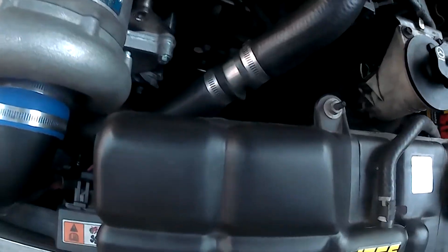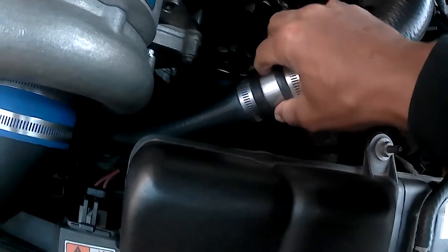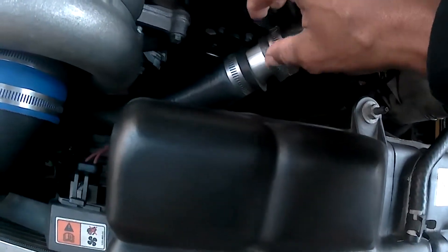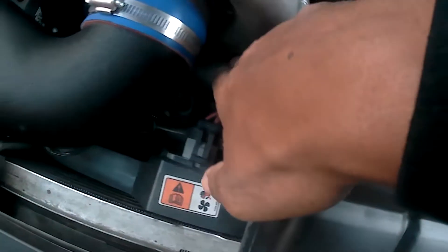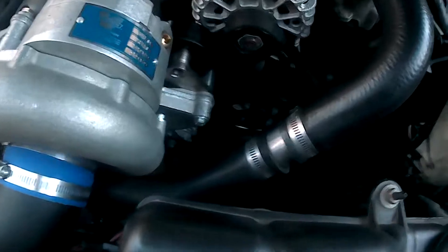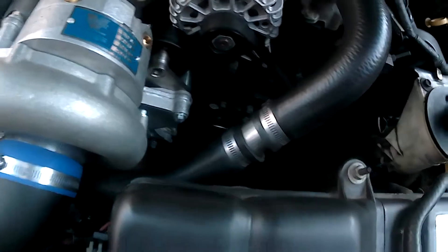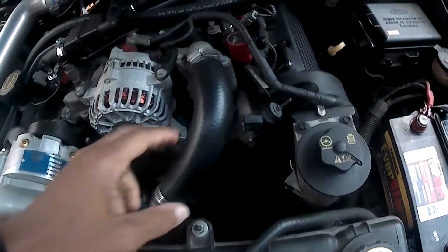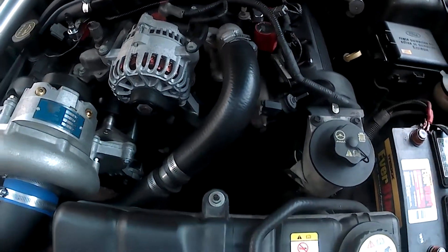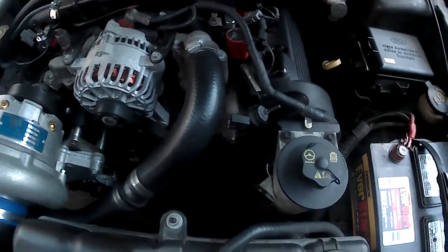As you can see, this is part of the kit — you will have to cut your radiator hose. This fitting actually spins, and really all we're doing is spinning that radiator hose to run up under the piping and come back up to your radiator to clear it. The only thing you'll have to do is cut the hose in half, insert this piece, and attach your two clamps. First thing I did was drain the oil out of the car and also drain the radiator fluid. Last thing going back together was just making sure I put fresh antifreeze in and topped everything off.